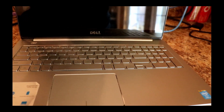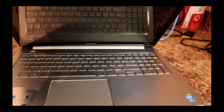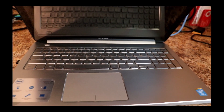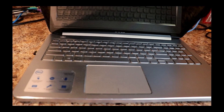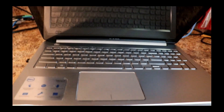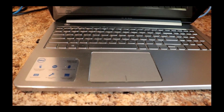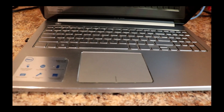If you don't do this, the hinges will seize. When they seize and you go to close or open the lid, the seized hinge will pull the hinge mount right out of the base of the laptop and strip the screw holes. The original screws that hold these hinges are very small and the holes are easily destroyed.